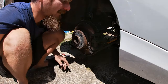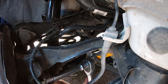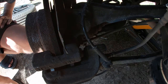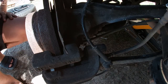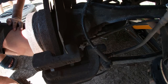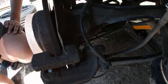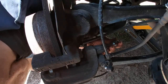Okay, now the plastic is off. So we'll undo a 16 bolt over here and one down here. But as in the front, first we'll use the screwdriver to release the tension from the disc, pushing the caliper piston in. Also, if anyone wants to buy discs, pads and calipers — they're like brand new, ATE, maybe 4,000 kilometers on them, even less. Really good condition. And not to forget, we have to remove the handbrake sensor.